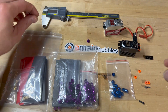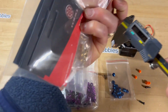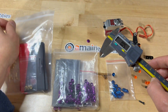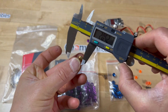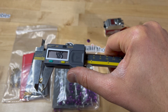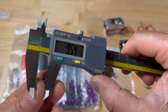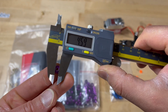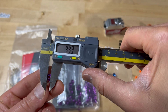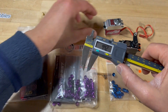To make things even more complicated, for Torque servos they do make spacers, which is great. They work both on Torque and KST — they're meant for a 4.86 spacer for a 5.0 millimeter hole. But for the Futaba type servos, these are actually shorter — 4.42 or 4.3 — so they fit the 4.5 millimeter holes. The MKS ones are actually even smaller.